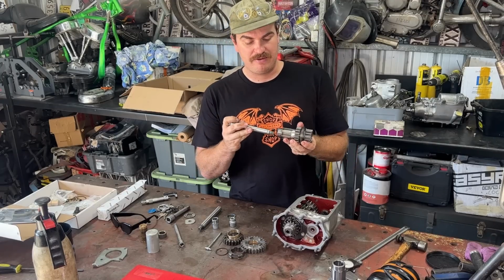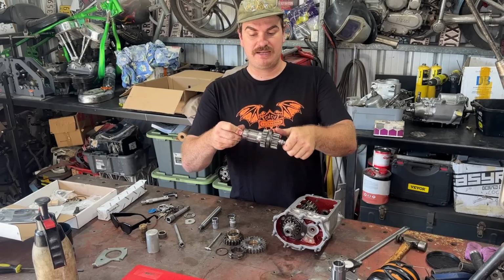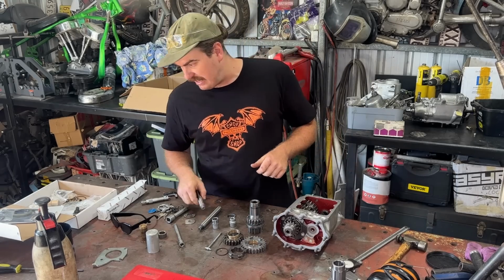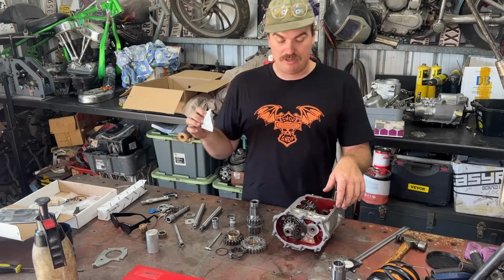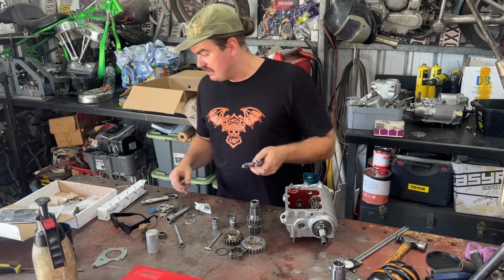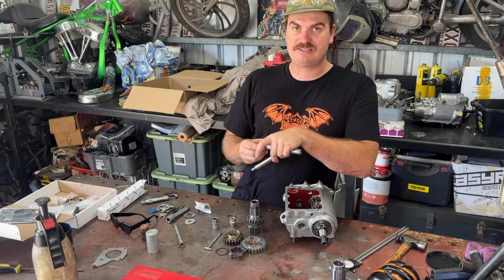I've pushed the new bearings in there and that thing goes in there really smoothly now. Look at that. So this is what we're going to use now. But because we've changed the countershaft by 5 thou, I had to knock in a new bush into the gearbox. This bush on the end is what the countershaft goes through. Now, if we have a look at our old bush on the new countershaft, it is really sloppy.